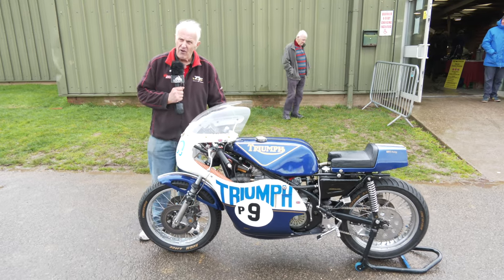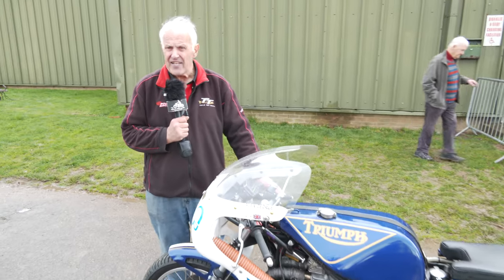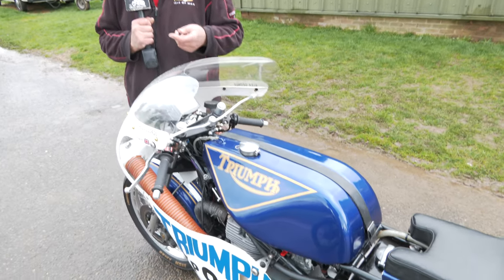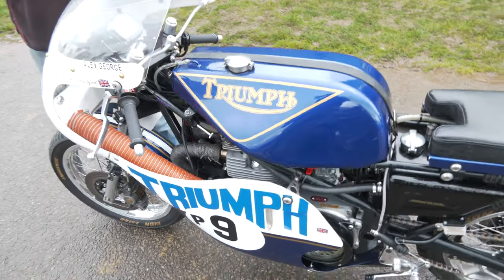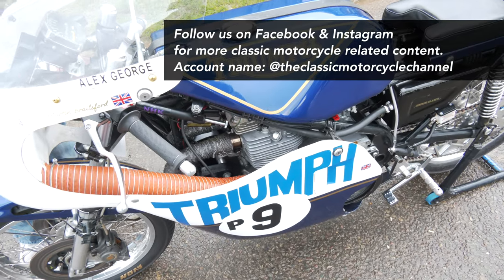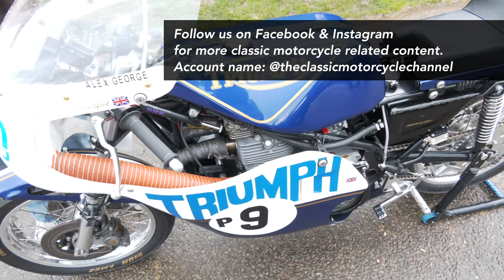Okay, well, this one's had quite a lot of modifications from the original bikes, things that weren't available in the day. They've got different con rods now to what we used to have. We use a billet crankshaft, a one piece crankshaft. It also has a high flow oil pump, and that's not high pressure but high flow. It creates more flow going through the engine.